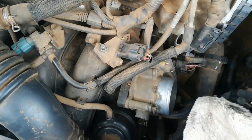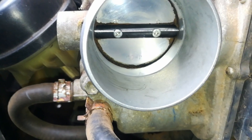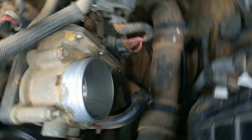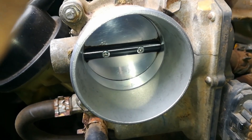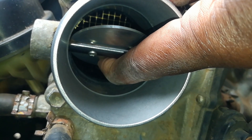This is dirty work, but if you persist with it, soon you will have your throttle body looking clean. Don't forget to clean the inside portion by pushing the butterfly valve open so you can clean inside. As you can see, the carbon buildup in there is heavy, and that's what may be obstructing our throttle or butterfly valve from opening and jamming the TPS. At the end of it, you should have a clean throttle body like this.